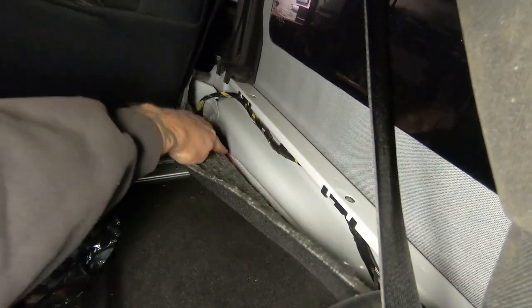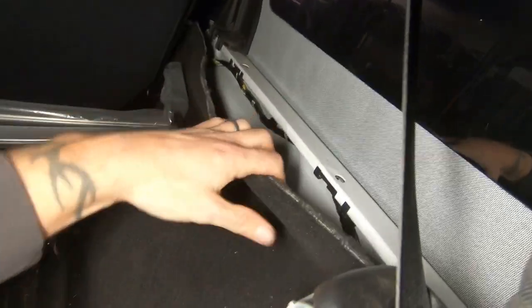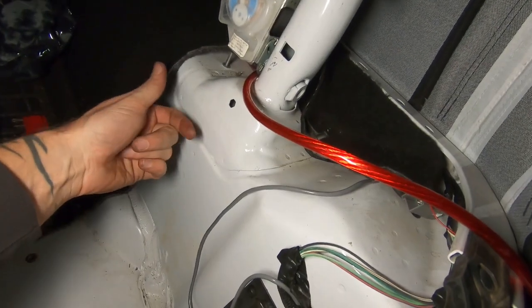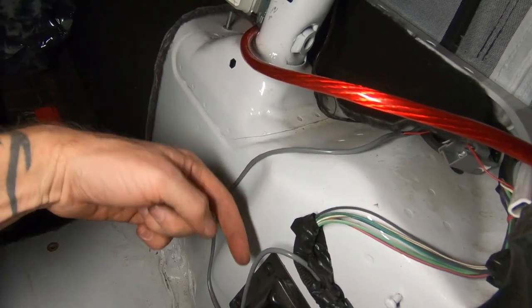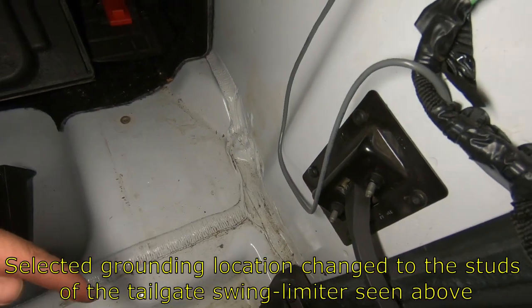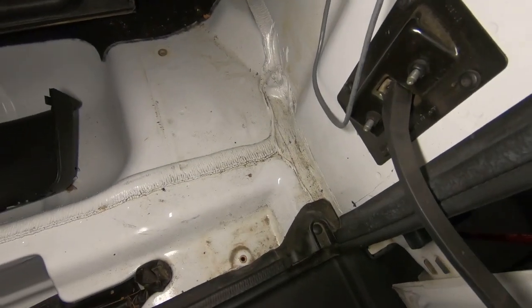That's where we left off. Now I'm going to let it run through here and see how much cable I have. If I have enough, I'll run along this and secure it all up with zip ties, and it's going to go down through here, enter the factory sub box, and go to the capacitor positive. I'll run another wire off the capacitor positive back out this way, run the ground down to here, ground the amp here, and then the power cable will plug into the amp on the side.